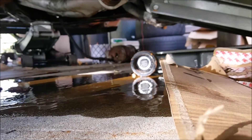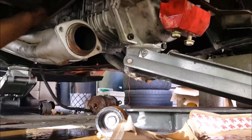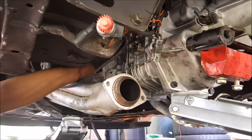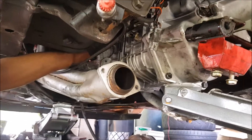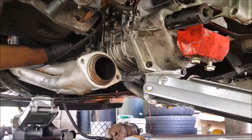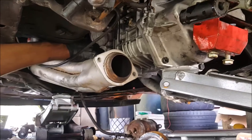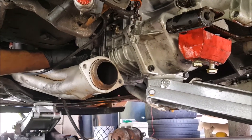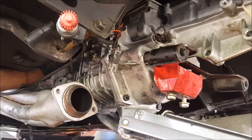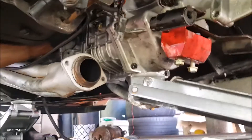Check this out folks — there's transmission fluid everywhere. Bolting the transmission up is kind of a time-sensitive operation. My plugging idea failed miserably and we leaked a lot of fluid, but it should still be fine — I shouldn't have to add any. What I found out is that once you get the transmission all lined up it'll go mostly in, but if you get stuck about an inch from the bell housing, press in the clutch and it'll slide right into place. That's a little trick I found. Now we're about to bolt everything up and throw the driveshaft in to stop the leaking and move on.